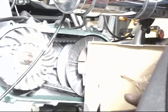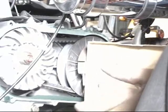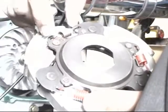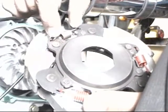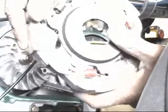There are several benefits to using the Dr. Pulley clutch. What we found is that it has a higher throttle response and engages quicker. It's got more power for hill climbing than, let's say, the stock clutch. So it's definitely worth it. It all has to do with these springs. Again, having the dual springs in there allows it to have more grip force. They're going to extend, and the clutch weight is going to extend and touch the clutch bell, so it's going to engage.